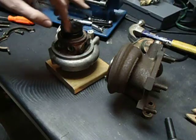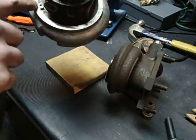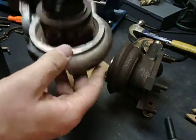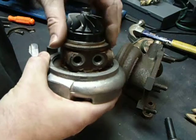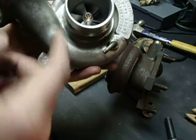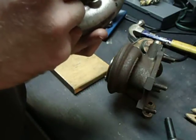We're rotating this around. I don't hear any scraping, which is good, so we know it's centered. When you get the snap ring in, you can kind of push on this to get that O-ring to compress — that's on the cartridge here. You can push it in, maybe tap it a little bit with a hammer equally. Just tap it gently, don't tap it hard, because you could skew it one direction and have the compressor wheel hit the inside of your cold side, which is not good.